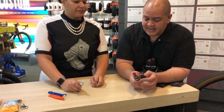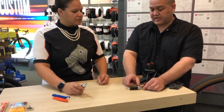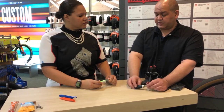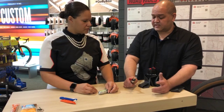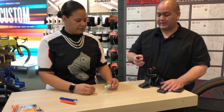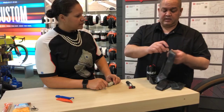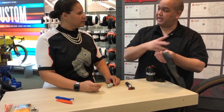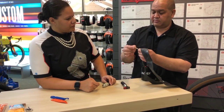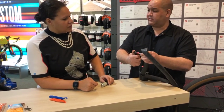Ideally, you want to carry a few of these with you — these are typically single use. You can get these in different sizes, the most common being the 16 gram. The other option is the 25 gram, which is larger. If you're doing a road tire, for example, the 25 gram would be more than enough — you'd have air left over. Just know that if you put that back in your seat pack, you run the risk of it leaking, so the next time you need it, it may be empty. Once the CO2 is punctured, assuming you've got your tire and tube put back in your wheel, press the valve — that little skinny metal valve — make sure that's unclipped. The way the Air Rush valve works, put that on the tube and press, and that inflates your tube.